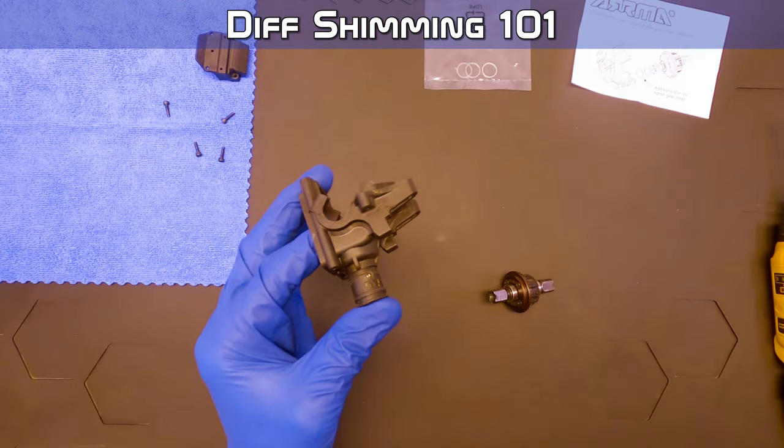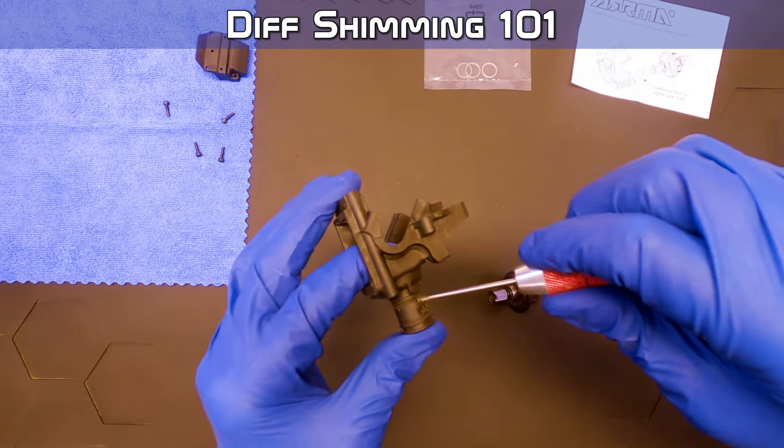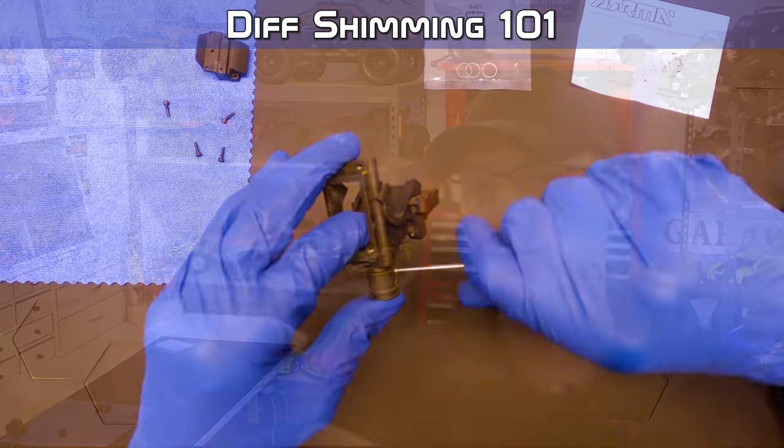But don't forget guys, when you go ahead and put this cup on, suck the slack up with your thumb and pull it in and tighten it down. Don't squeeze it because those gunnels that those ball bearings run in are fairly small on these kind of ball bearings and it will wear the material out faster. If it's not spinning freely, you've got it too tight, but it shouldn't move back and forth.